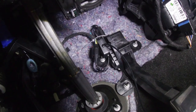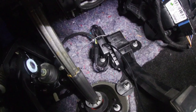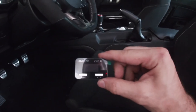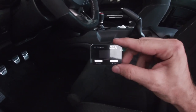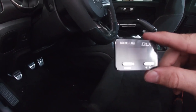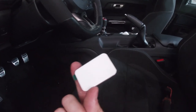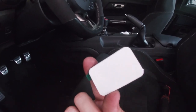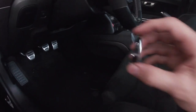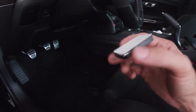Now we can route the harness from that box up through the dash to the throttle body controller. Where you mount the controller is all based on personal preference — keeping in mind you're going to want to be able to read the display and access it relatively easily. I would avoid putting it directly behind the steering wheel on top of the steering column. Before you remove the double-sided tape backing, place it roughly where you want to position it and route the harness to make sure it even reaches the port — otherwise you'll have to remove it and the tape won't stick as well the second time.